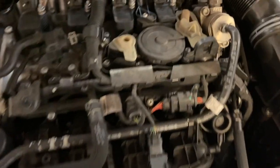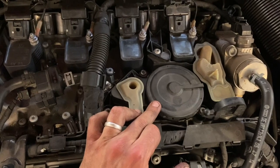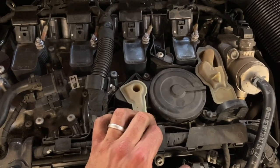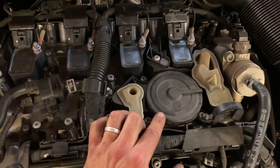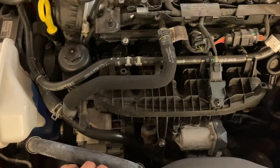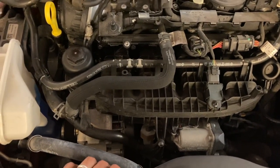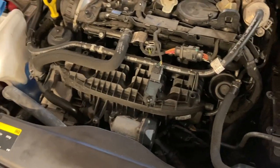Just rolling the covers off — you can see on the top here this is a PCV valve, which is a really common issue on these MK7 Golf Rs. I've put another video on my channel about replacing one of them. Also this inlet manifold — there's a sensor for the flaps that plays up and you can't get the sensor separately, you have to buy a whole new manifold. I've done another repair video on replacing that as well.